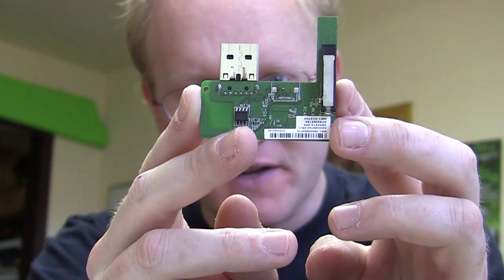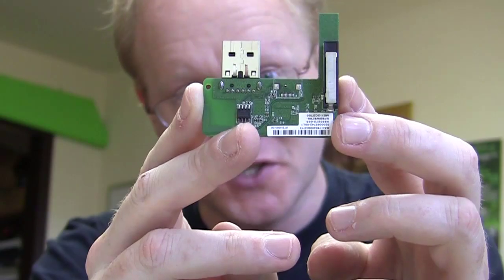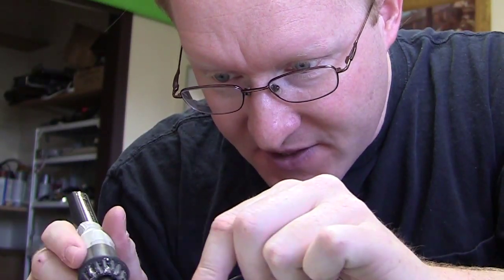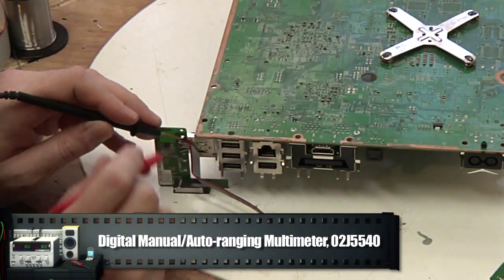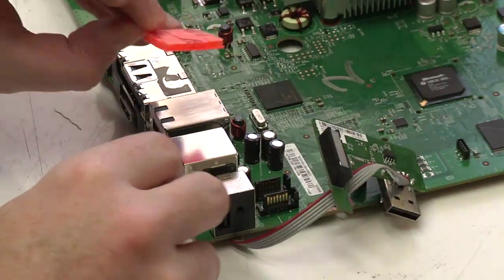The ring of light assembly and the wireless adapter are the two most obvious ones that jut out. Luckily, these both unplug, so they're meant to be removed, which means we can remove them easily and rewire the connectors. There are actually two grounds, so we don't actually have to re-hook up everything, just the discrete connections. To make it easier to solder wires, I'm going to add some lead solder to each of these points. We've attached wires to the wireless connector and plugged it back into the motherboard to double-check connections. It's good to double-check this stuff, then rewire it slowly so you know you're doing it exactly right. Now we're going to put some Velcro here to mount the wireless.